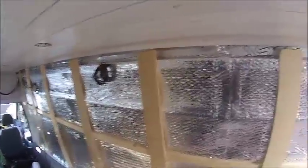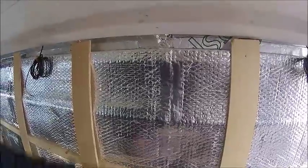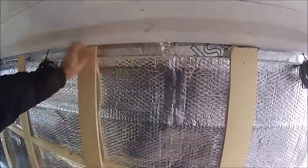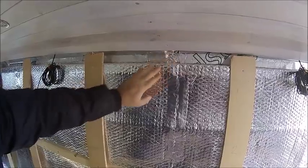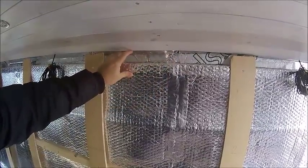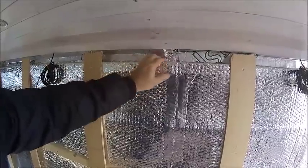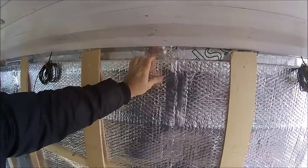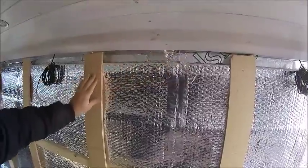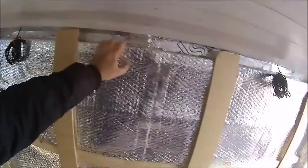I've left myself a channel right the way through the top here, goes right the way down the full length of the van both sides. That's going to be a service area. So when I come to do the last panel at the top, I shall make that removable — I'll cut the tongue and the back of the bottom off — so I can take it off and run all my cables through there. I've also got loads of room behind these to run cables, but it's only going to be that top bit for the lights.